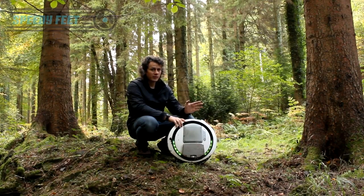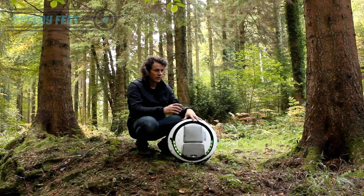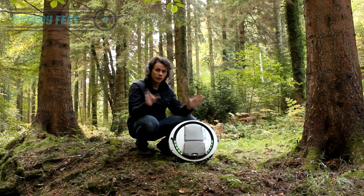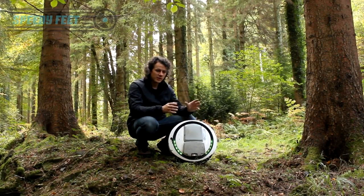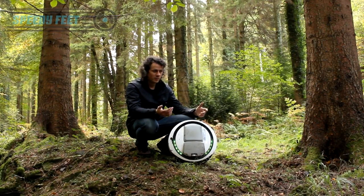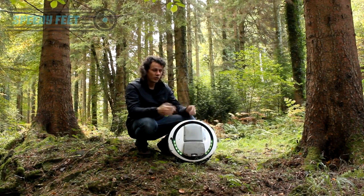and I would actually recommend running it at a minimum of 50 psi, because what we're finding is with the bicycle tyres being put onto unicycles, they're rated for the weight to be split across two wheels. So if you look at the ratings of these, they're not substantial enough to be put on an electric unicycle, essentially. But it's all down to the PSI.